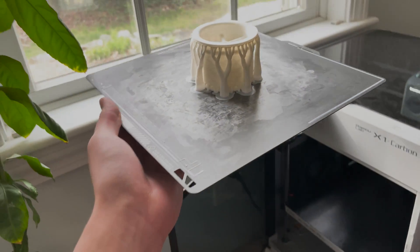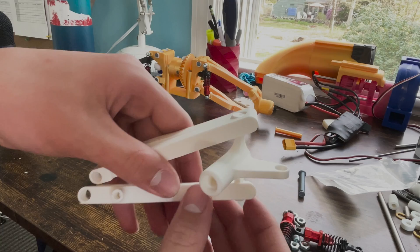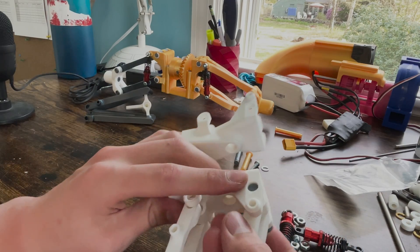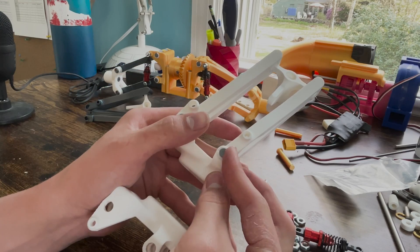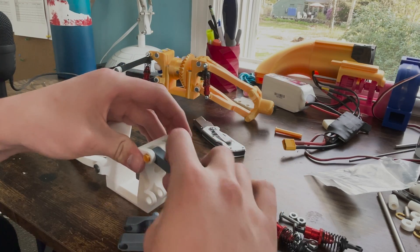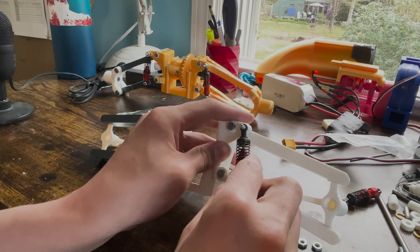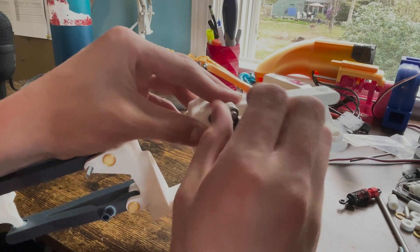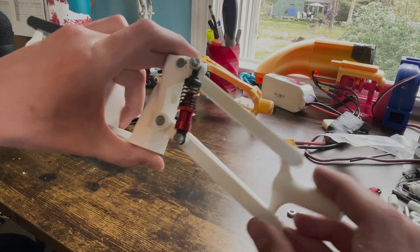And here it is, a fresh wheel. The next thing that I wanted to take care of was the front suspension. During the design of this part, I reused the print-in-place ball joint concept that I first made when working on my mini RC car. The wheel hubs were designed to snap into these ball joints, which were permanently embedded in the swing arms. The orientation and location of the suspension is exactly the same as it is in the rear, just with slight design changes to adapt to the needs of the front.